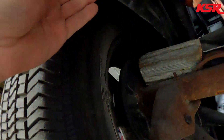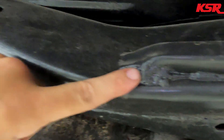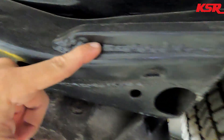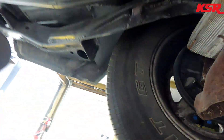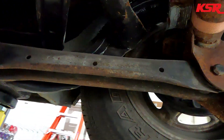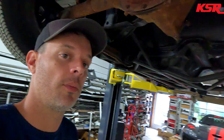Years ago when I notched the frame I didn't do a great job. This little tubular brace here — what in the world is that welding? That's terrible. I'm going to cut this out because with this bar in there it doesn't need all that — the frame rails really don't do a whole lot on these cars once you add all the chassis work. What I'll probably do is cut the frame rail off somewhere in here, get a new rear section from a donor car, and add the frame rails back in so I meet the rules for the stock frame.